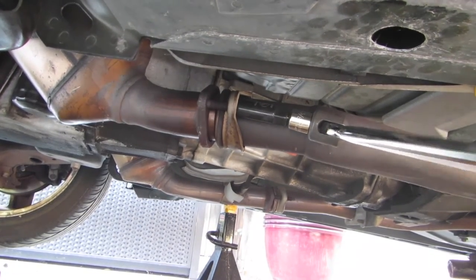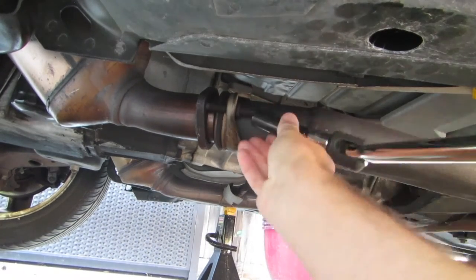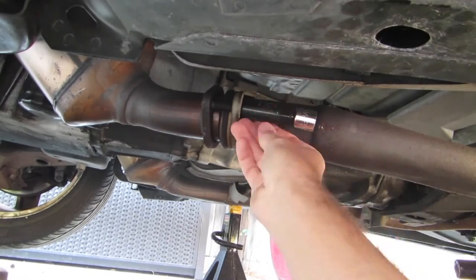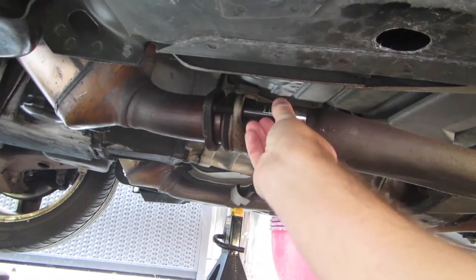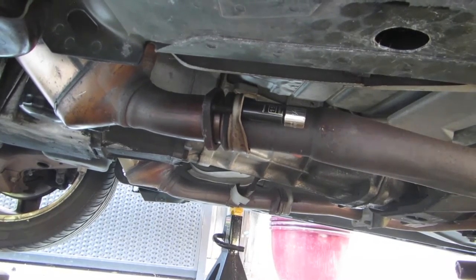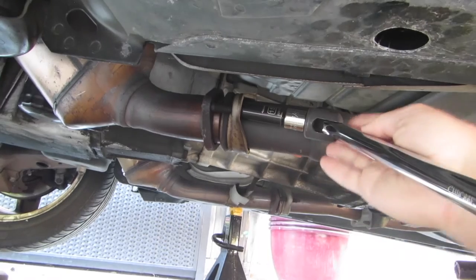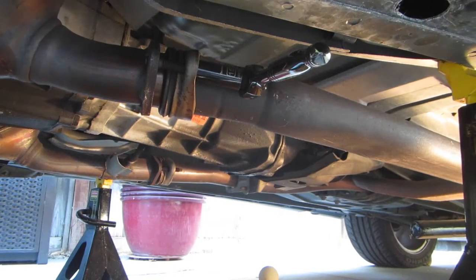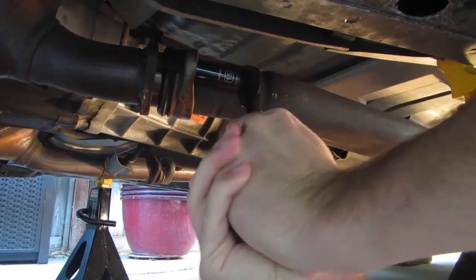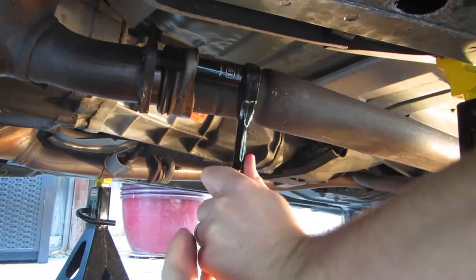That's a good sound. Man, there's so much play — it's terrible. So I had my 5/8 socket on there and that had more wiggle room in it. The 15mm is a little tighter. There's just not enough space between the end of the breaker bar and the ground. Since I think we've got the nut to budge a little bit, I'm going to try just the regular ratchet. Yeah! There we go. I couldn't loosen it anymore with the breaker bar, but the ratchet — I'm all set.